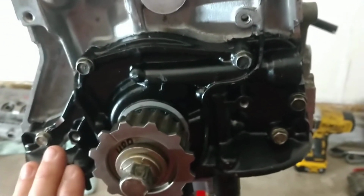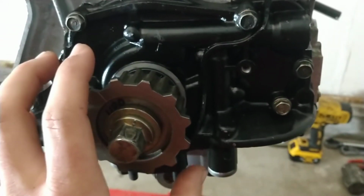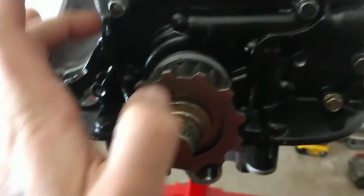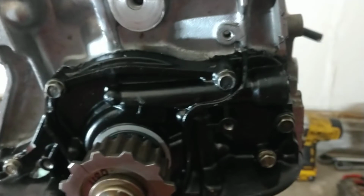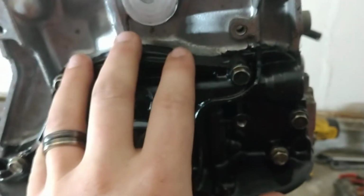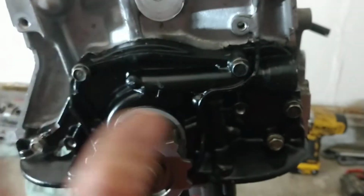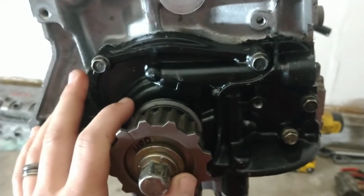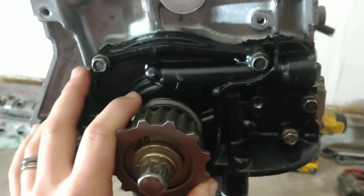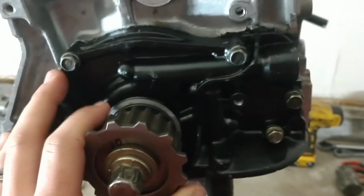There's only 5 bolts on this? Yeah. So putting the oil pump on is pretty straightforward. Just make sure that your surfaces are nice and clean. Same thing for your oil pump, which should be new. If you're doing a build like this, it should be new. It should be high flow. The D16s are well known for oil starvation under turbo setups without some type of upgraded pump or pressure system.